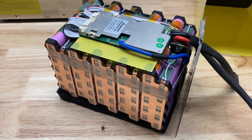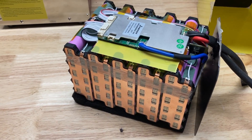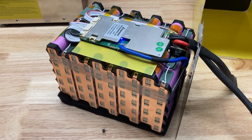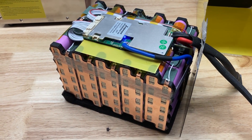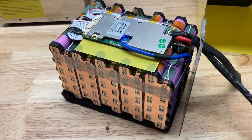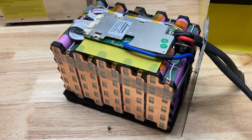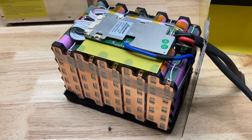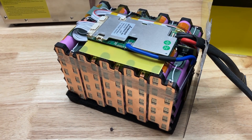So trying to figure out what's going on here. Before cutting the pack open, the first thing I did was try to reset anything I could in the software — that didn't work. There are no wiring issues on the pack; it shows all the voltages of the subgroups and they all look normal.